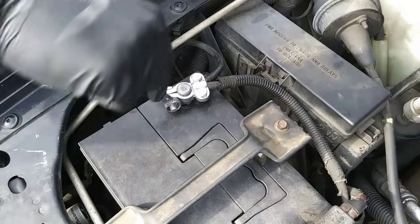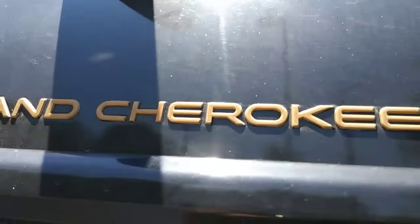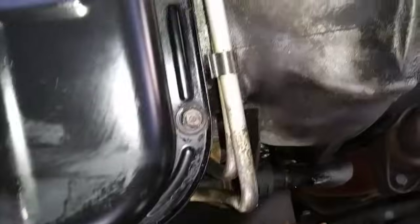You want to begin by disconnecting your negative battery cable and setting the emergency brake. The transmission pan is located next to the front drive shaft, and you may need to use rhino ramps or jack up the front end to give yourself more space. But all 14 transmission pan fasteners are out in the open and extremely easy to get to.